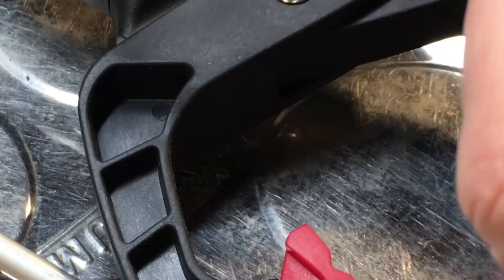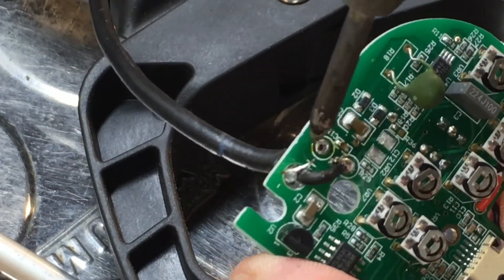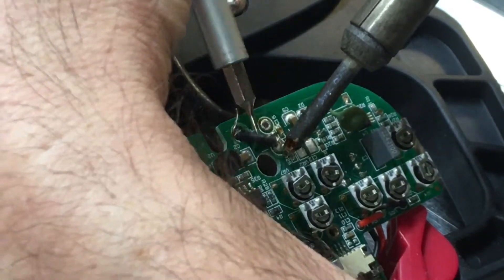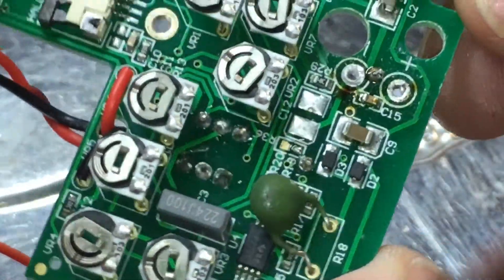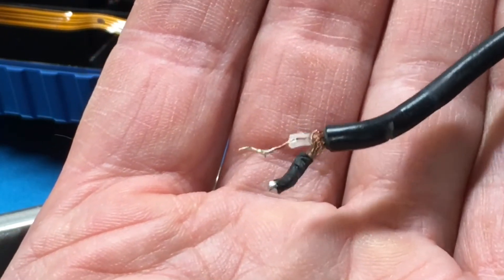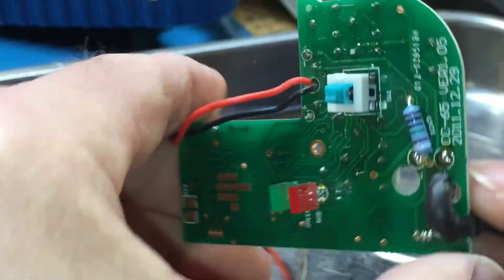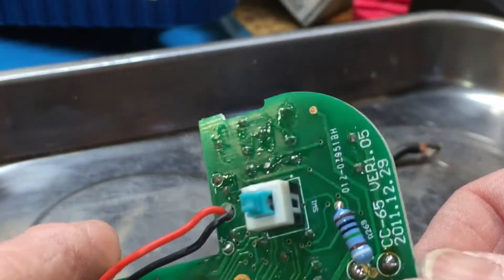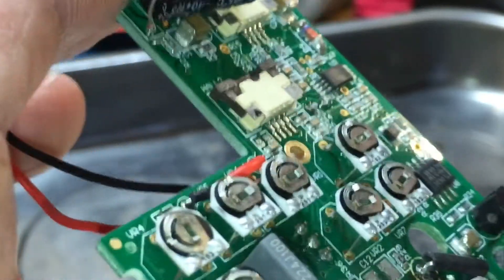Not pretty but done. That's the core - you can see on the board there's a little plus sign. There's the wiring extracted. You can see the original factory installation: the core and the shield - they've just slipped a little heat shrink over the shield. I'll do the same. Soldered back as best I could. Very tiny wires - put any force on them or nick them at all and they'll break. I had to redo it a couple of times, but it's satisfactory I think.